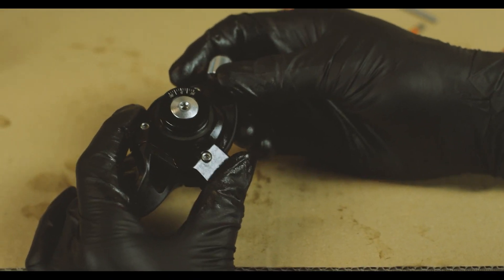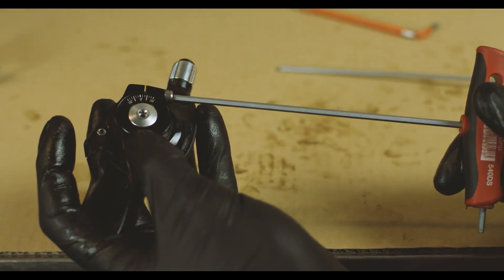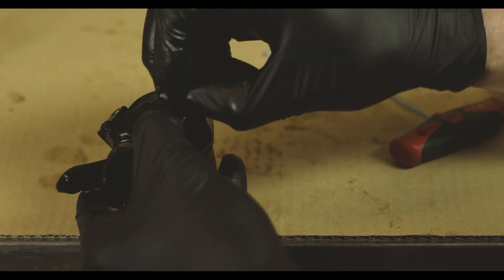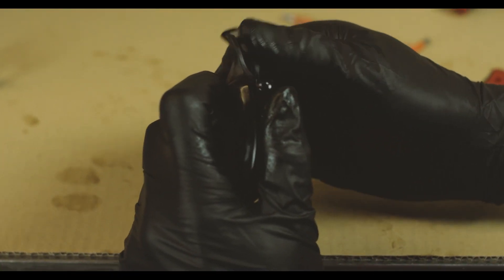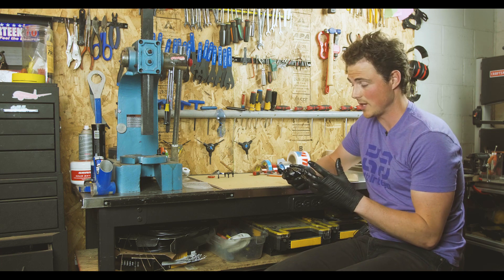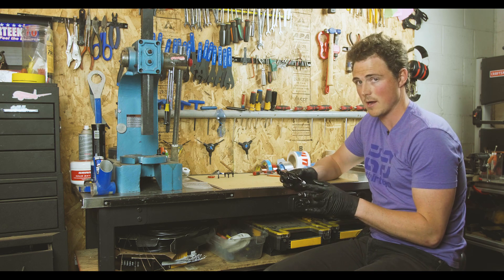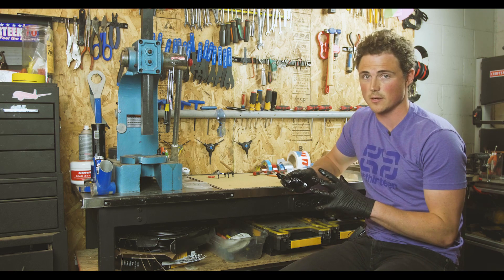We should be safe to reinstall the lever now. If you're planning to put this shifter on a bike right now, install the cable before you put the cover back on. Give it a few test clicks. So now we've successfully upgraded our 11-speed X01, X1, or GX shifter to work with a 12-speed drivetrain. If you're running XX1, stick around — I'll show you how to do a few special steps for that shifter. If not, feel free to skip ahead to the derailleur segment.